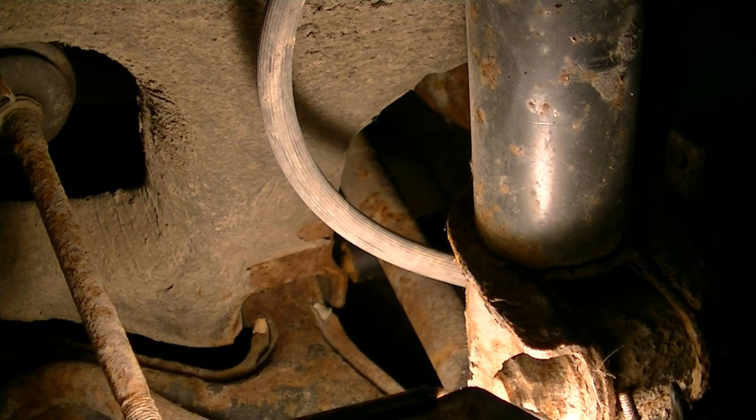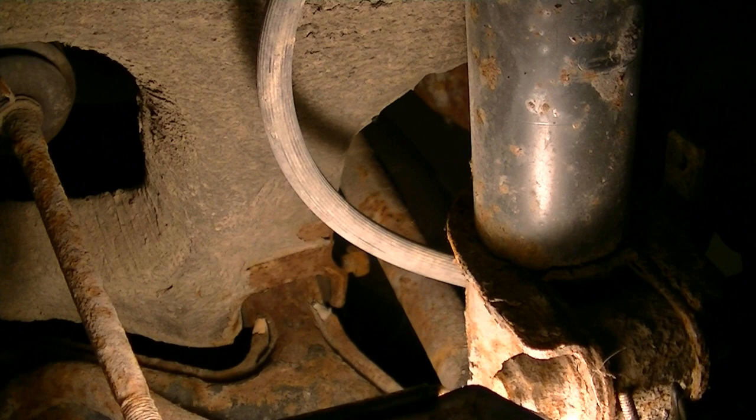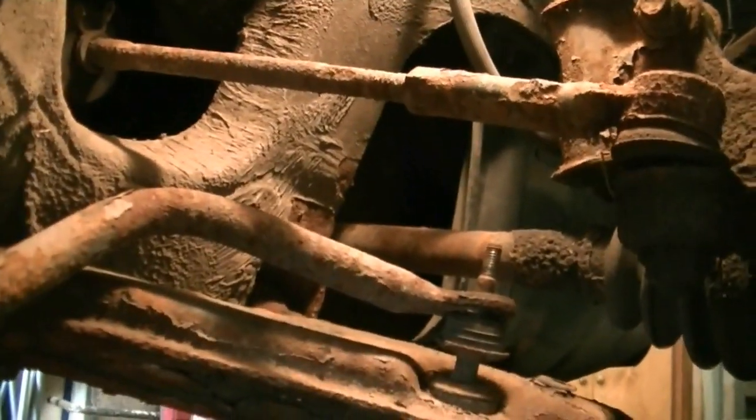Running out of air pressure — the tank can't keep up. That's alright, she's pretty much out now. Need a bigger air tank, so I'll just get a ratchet on that and finish bringing it out. Got that bracket off — that's right here, two 17mm bolts. Now I'll try to pry up the stabilizer bar, take the last bolt off the ball joint, pivot it back and forth, get the rest of that front mount bolt off, and then it's just a matter of doing the opposite to put it on.